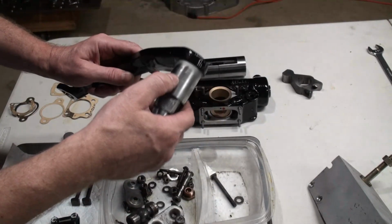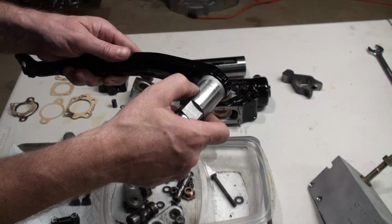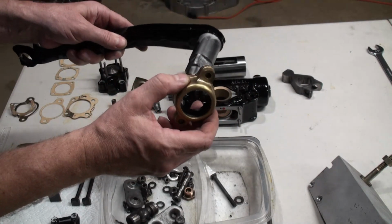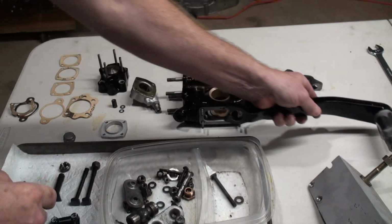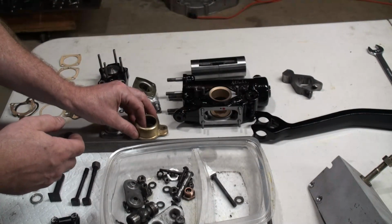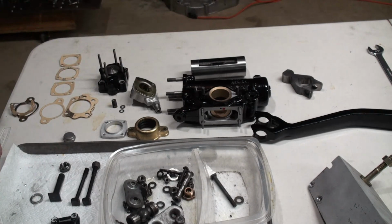You'll notice that there's a little bit of wear on the shaft there from the tallow seal. And the nice thing about putting in 3 modern oil seals is that it won't be in the same wear rut as it was with the tallow. So it'll be a very effective seal. That's just a small amount of wear and nothing really to worry about.